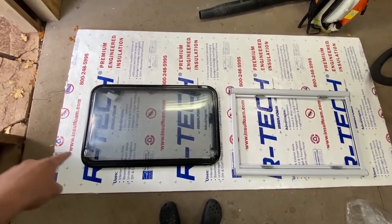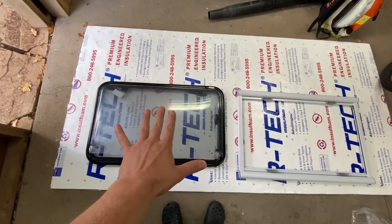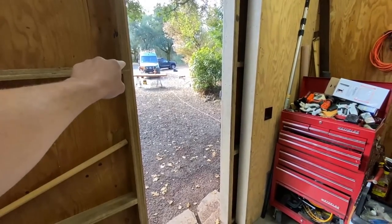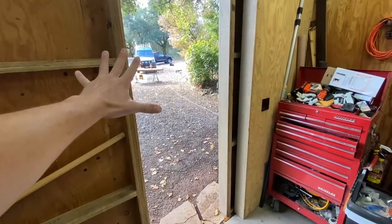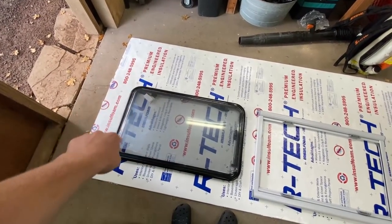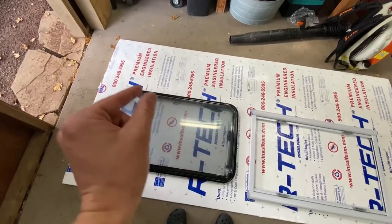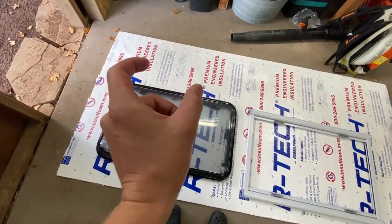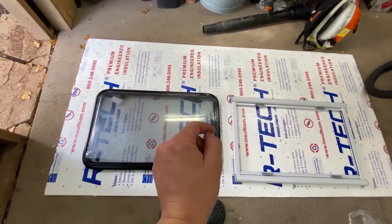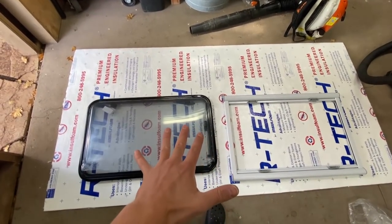What we're going to do is make a cardboard template the same size as the cutout we need for this window. We'll then go out to the van and cut a massive hole into the side. Once the window is in, we need to make a frame out of 80/20 aluminum — it goes outer window, outside trim ring, the 80/20 frame ring, inner trim ring, and then the additional trim. Sounds a little complex but we'll go step by step.